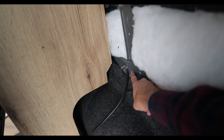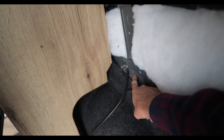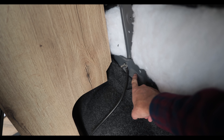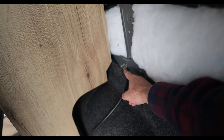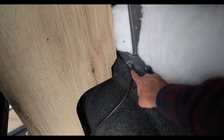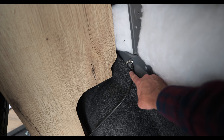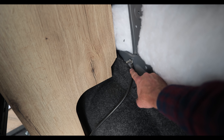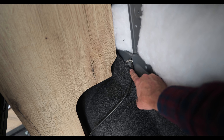For your ground you can either find a common lashing point — as long as it's a good solid piece of metal. I've got good continuity here with this wheel arch; there's a little hole here, so all I've done is pushed a nut and bolt through and scratched a bit of the paintwork off for a better connection for my DC-in. This will effectively create a loop because the vehicle battery is grounded to the van. My DC-out 12 volt out will also be grounded here as well.